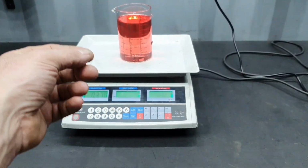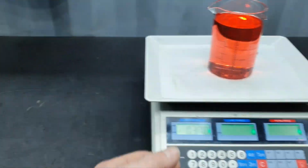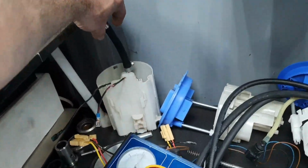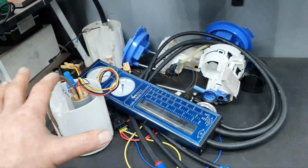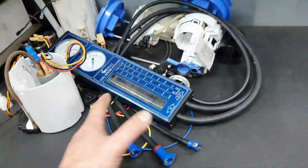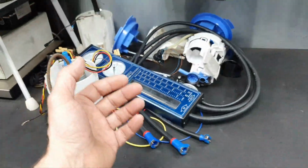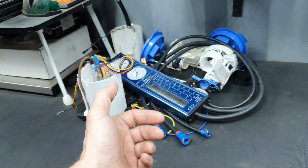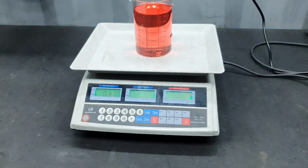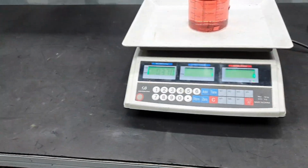This is one test before I run a test for the pumps. I'm actuating, let us say in this case, the original pump, then the aftermarket pump, with the same cables, same battery charger, everything the same, to not have variables, with the same gauge. And what I'm doing, I'm getting my timer and I see, let us say in half a minute, how many liters you convert. How much fuel you can pass with the stock one and with the upgraded one, to see the difference.